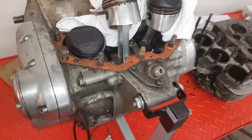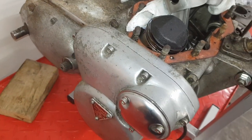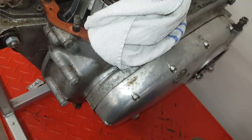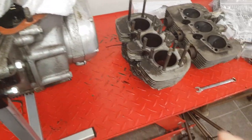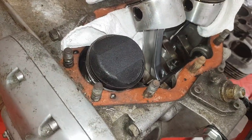So those are two different ways of releasing the barrels. Heating up the joint is a really good method especially for things you can't get to, like the timing case or the primary - it's very difficult to find anywhere to lever. So heat everything up with a blowtorch and it will come off. Mike Close reminded me about using the cylinder nuts to push the barrels off, and Jeff Mitchell reminded me about the blowtorch method.